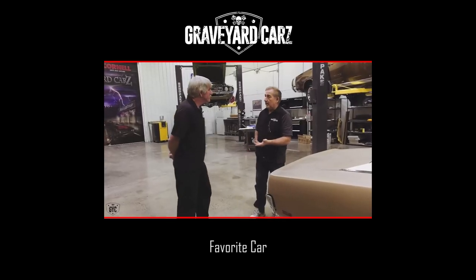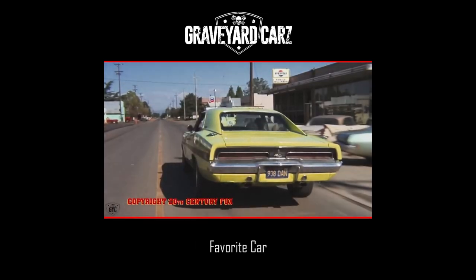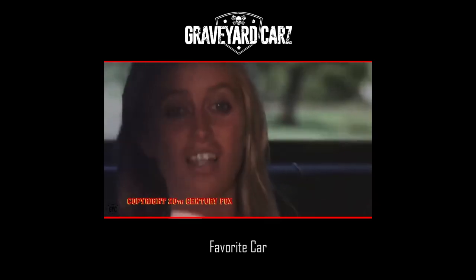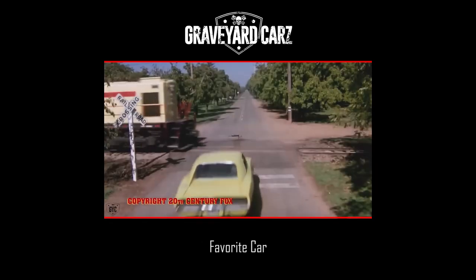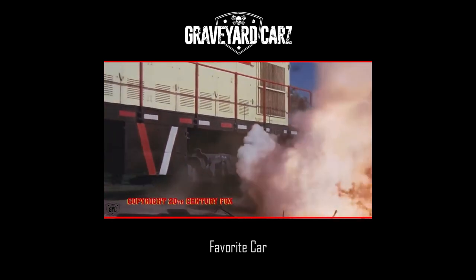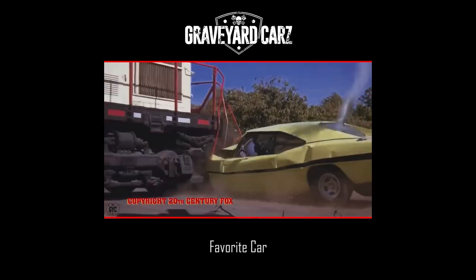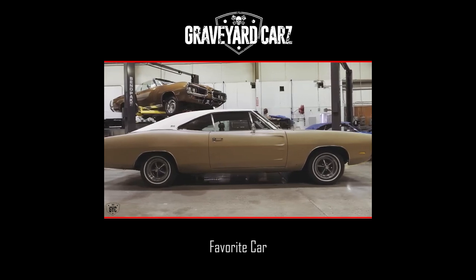It also probably started life as a vinyl top car, but they painted the top the same color as the body. If you look carefully at the pictures, you'll see that car has these moldings on it — they wouldn't have put those moldings on without a vinyl top, just like our '68 Charger. And if you look carefully at the wreck scene at the end of Dirty Mary and Crazy Larry, right after Mary says 'I think I'm ready to unload,' they smash into that train — that's a real '69 Charger. Watch the secondary damage go throughout the entire car, all the way through to the back window. That hit is an example of how a unibody will transfer damage where a subframe car won't, because it's all one piece — it lives together, dies together, wrecks together, spreads together.